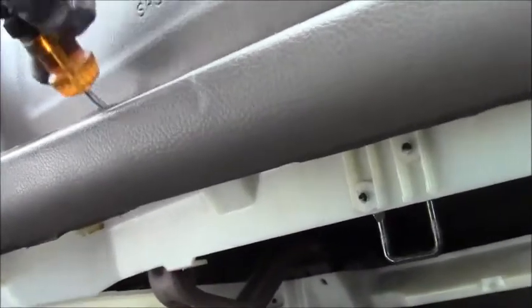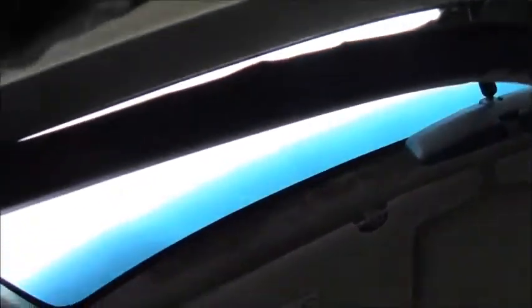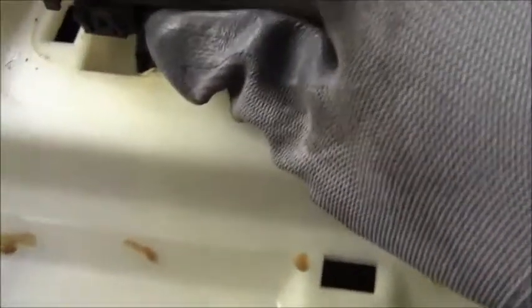Get this airbag out of here. It should just be a matter of convincing — let's just push on the back of it. I'm using a really flat, fine flathead screwdriver and you've got to lift these tabs up out of their sockets. You've got to convince this airbag to come out. Use a very flat flathead screwdriver so you don't mar or scratch up the finish.